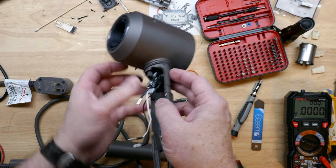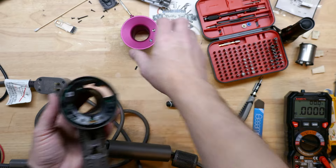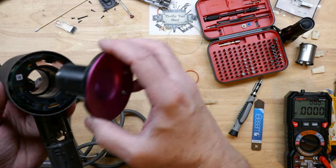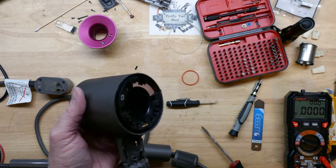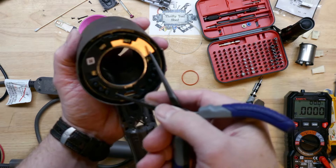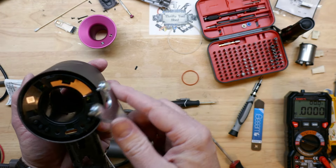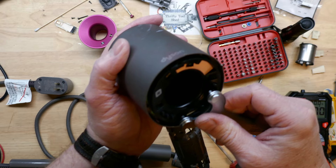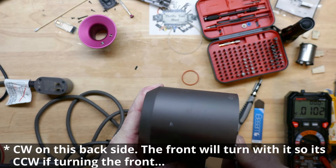This is the part I was talking about — hold your wires so they just push up into the cavity, because we have to rotate the whole heater and mainboard assembly. The way these clips are, you could probably rotate it by hand but I wouldn't want to break those tabs. I usually use something like a spanner wrench. In previous videos I've used long needle-nose pliers, but a side grinder wrench — like this Milwaukee spanner wrench — happens to fit well enough to rotate it clockwise.